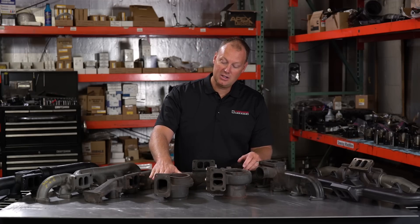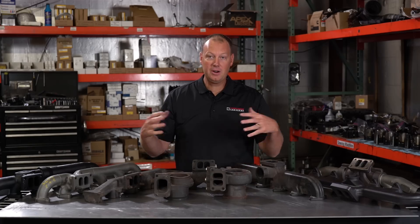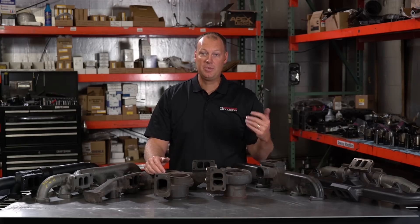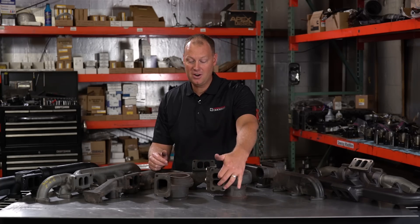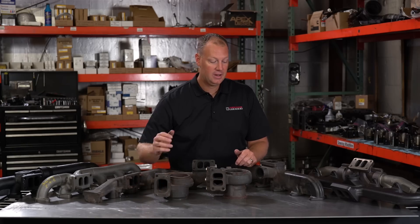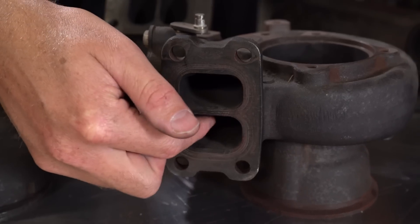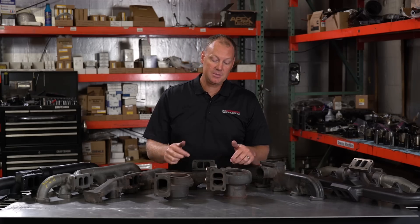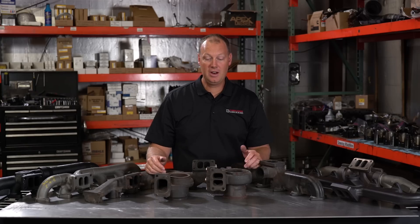You'll notice this is very small — this is an open volute housing, but it's very small compared to something like an HX35 housing. They can still spool up fast because it's small. But if you start going bigger turbos, you'll notice a lot of the T4 BorgWarner T4 and T6 turbos are this divided design because they want to help it spool up. So you want to make sure if you have one of these divided turbos, you don't want a manifold that's open. And vice versa — if you have an open turbo, you probably want an open manifold. One advantage of the divided housing is that this twin scroll design is better for spool-up; however, the cast iron type does crack. Give me a turbo with 10,000 miles on it and there's going to be little cracks. If you go really high performance they'll crack more. The billet type doesn't crack near as often.